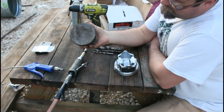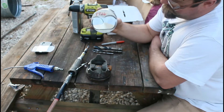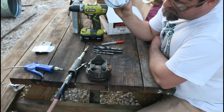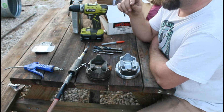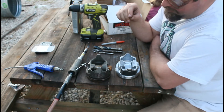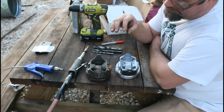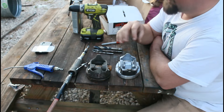We've got the weight of this one with rings, pin, and everything — this is 18 grams heavier. What we're trying to do here is keep from having to take the crank and rods and everything to the machine shop, since we're using the same factory crank and rods. They're probably not balanced very well, but it didn't vibrate before, so we should be okay.